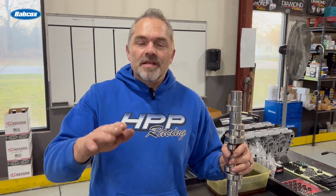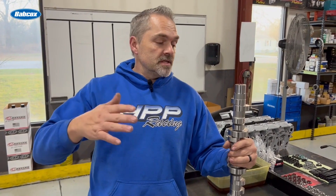They run it across their machine and he calls me back and says, 'Holy cow, does this thing break intake rockers?' I said yeah. He goes, 'I've never seen an intake lobe like this ever in my life. I've run it across the machine five different times trying to come up with different numbers, and every time this thing comes up with crazy deceleration rates on the intake lobe. There is no possible way — I can't even figure the math out of how much valve spring it would take to close this and keep the valve from bouncing.' I said, 'But the 50 numbers are almost identical, lift is identical, lobe separation is identical.' He goes, 'Yeah, but the acceleration/deceleration ramp on this intake lobe is insane — there is no way this is not going to break parts.'